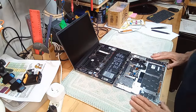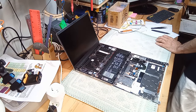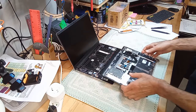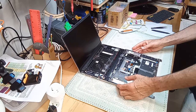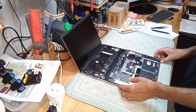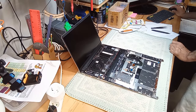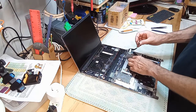Now what? Gently place the input cover side down on the bottom cover as indicated in the image. The cover should be about 1.5 inches away from the bottom of the main board. Okay, which is whatever 1.5 inches is. And then, in orientation, to locate the loop end of the touchpad cable, insert your finger into it. The loop end, and insert your finger into it. I see.